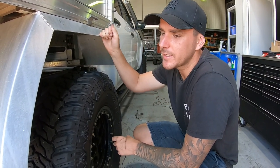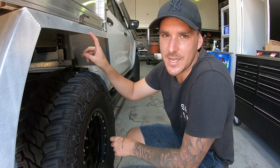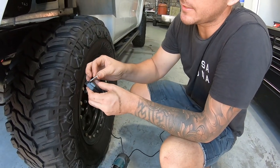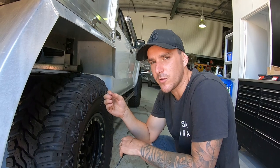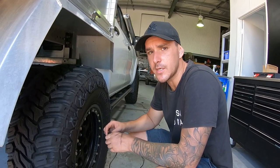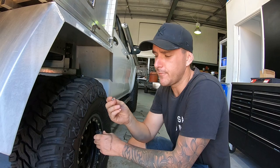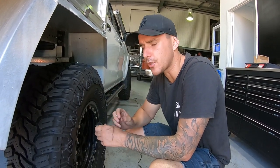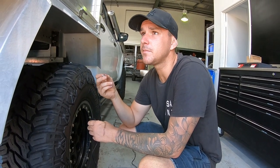Because we're going into this aluminium mudguard, I'm going to use some torx bits with a self-drilling head so we don't have to pre-drill. That's going to go through nicely and these things pull up really tight. For the front it'll probably need a bolt and a big washer because it's only going through plastic. If you have a tub on the back, remember that if it's plastic a small screw or little nut and bolt will eventually pull through due to vibration — so put a big washer on it. A screw is easier, but a bolt is definitely better for plastic.